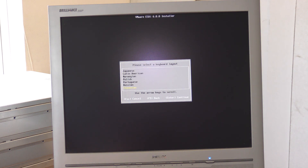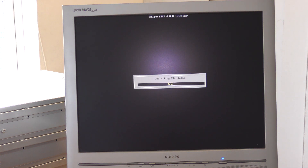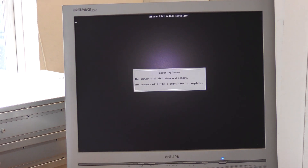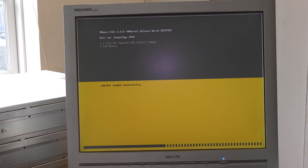Going with Danish keyboard layout and setting a password. It pops up with something I've never seen before — it says I have to upgrade the volumes from inside the vSphere web client. I don't care about that volume right now, so we'll just continue and install it. I'm not sure if it deleted the volume or if I can upgrade it later and still see what's on there, but it doesn't matter much. Installation completed. It wants to reboot, so I'll remove the USB stick now — my trusty old 512 megabyte USB stick — and enter to reboot.